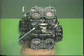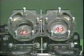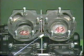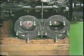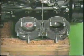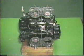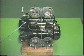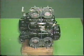The upper and lower head gaskets are different and are identified by white paint numbers. The number 1 gasket is for the upper cylinder head, and the number 2 is for the lower cylinder head. When installing, the gasket identification numbers should face up towards the cylinder heads. If gaskets are incorrectly installed, coolant will not flow properly, with possible engine trouble resulting.